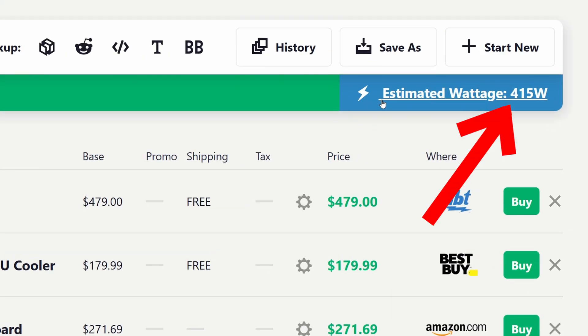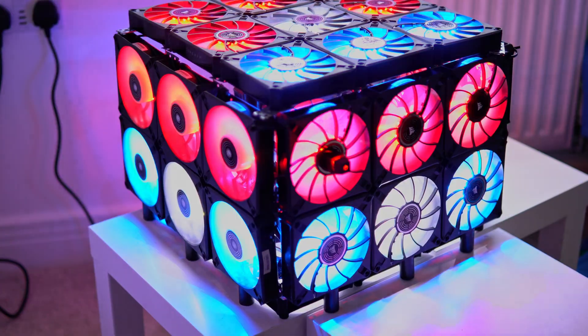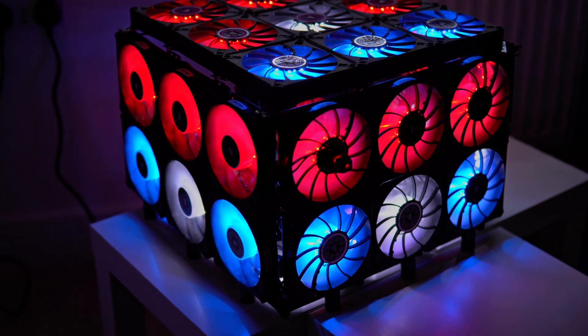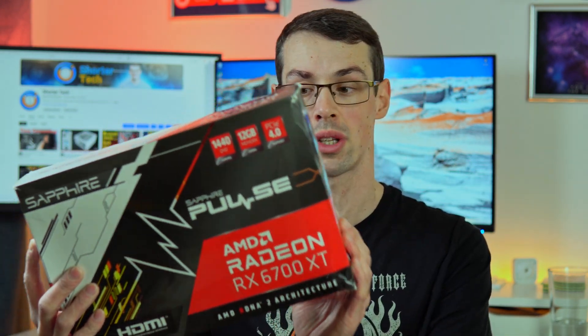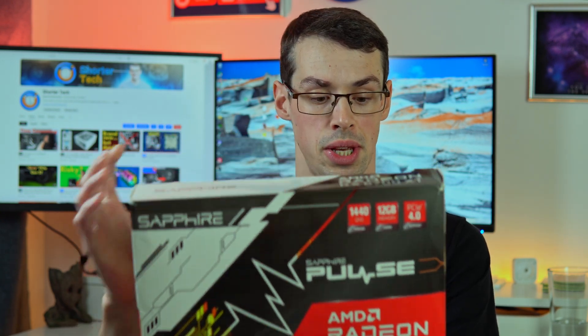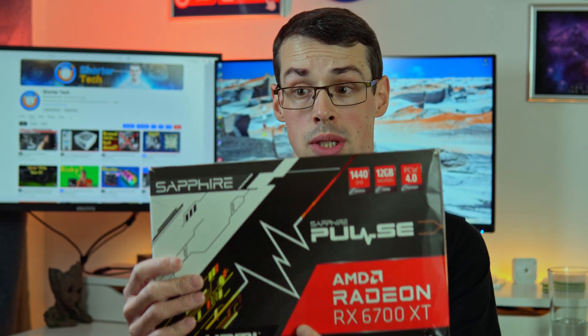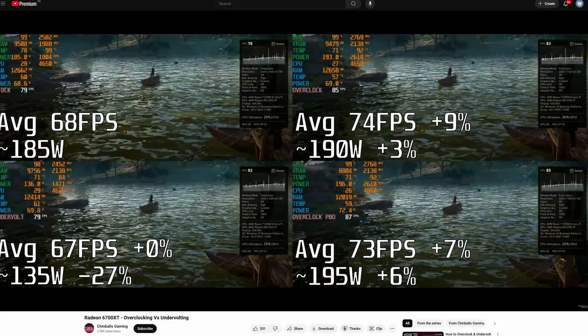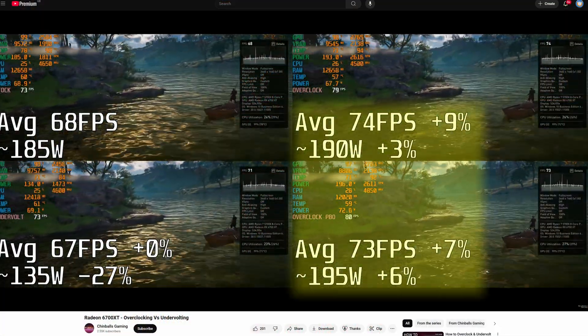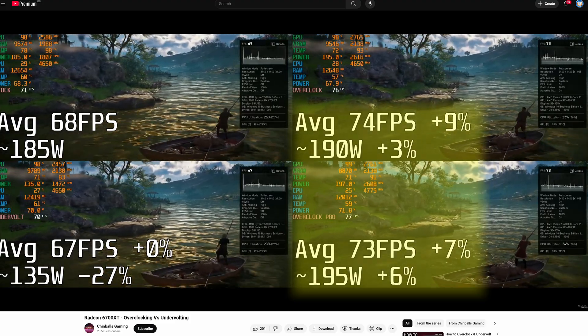But if you do have a really high-end CPU like the 9800X3D, and then you overclock it, and your system has five mechanical hard drives and 25 fans, you might then be hitting the power requirements if you max out your graphics card all the time, especially if you overclock your graphics card too. A key point is that at stock, a graphics card that says it needs 650 watts probably doesn't need a PSU with 650 watts, but if you then overclock it, it might actually need that, because often with overclocking you use more and more power.